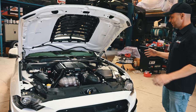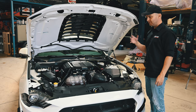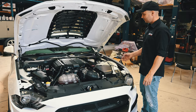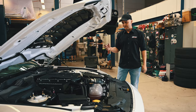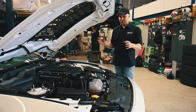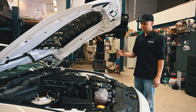The heart of the car is always the engine. We have a five-liter Coyote engine and we boosted it to 750 horsepower, because that was the goal — the power of a GT500 is the key where everything begins. We chose an Edelbrock supercharger with internals of 2650cc displacement. This roots-type supercharger moves the air to the engine without the typical screw-type supercharger sound — it's very quiet. The customer didn't want a loud supercharger noise; he wanted to hear more of the exhaust.